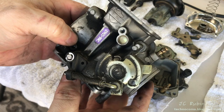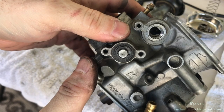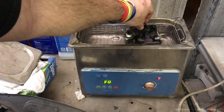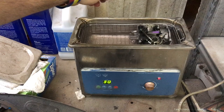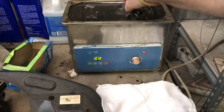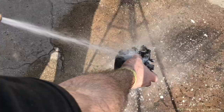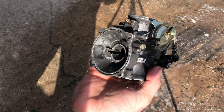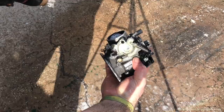Here's as far as the carb is going to be stripped down — really dirty on the outside. All that carbon buildup is going into the cleaning tank. We'll drop it in with a detergent for about half an hour. Originally I put it in with a basket, but it was easier to remove the basket to get the entire carburetor submerged. Ended up doing about two rounds of 30 minutes. Out it comes and the detergent is washed off — also blown out with air, then carb cleaner, then air again to clear all passages.